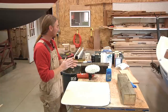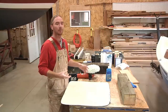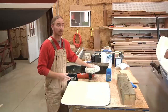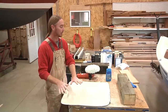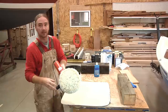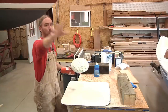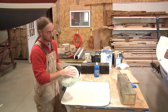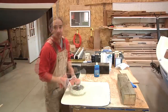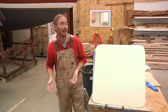I don't want to rely on the speed of the buffer to remove scratches — let the compound do what it's designed to do. If you need to go over it a second or third time before all the scratches are out, no big deal. Running the buffer at high speed risks heat buildup and you could actually burn your gel coat, so I run it on slow speed. I'll run a little bead of compound around the outside edge of the pad, then rather than putting it down and turning it on and having compound slung everywhere, I'll rub it into the bonnet by hand so there's no slinging when you turn it on.